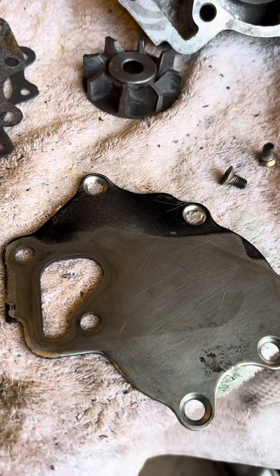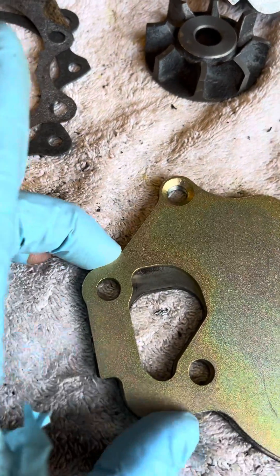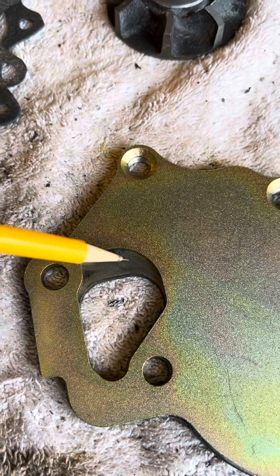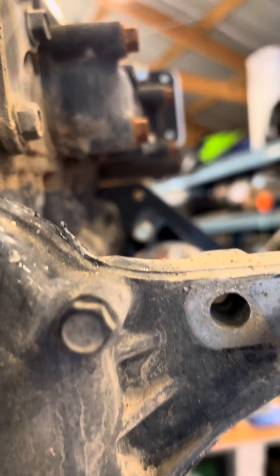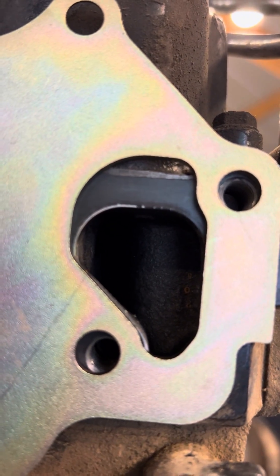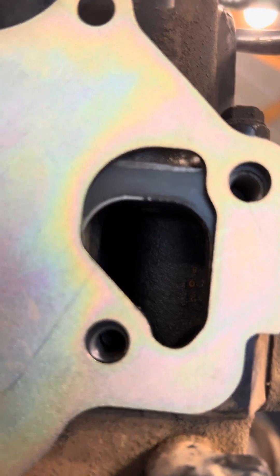The big difference is the backplate. This is the original backplate; here's the replacement. They all line up, they all fit. But this area right here — that's the edge of the motor housing, and above that is gonna be air. So if you go to put this on your engine, it'll bolt up just fine, but you're gonna have stuff spewing all over the top right there where the casting of the engine isn't.